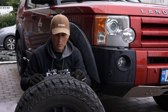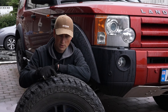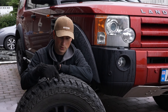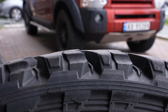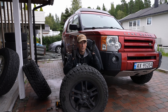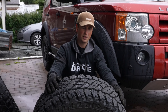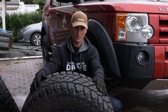On my tires, because the big lugs are split in the middle, I haven't seen much stepping from big lug to big lug, but if you look closely and feel it, there's stepping from one part of the lug to the other. The front part hits the asphalt first so it wears the most. I've been checking my tires every two weeks to keep an eye on the wear, and I can see that it's always the front part of the lug that wears the most.